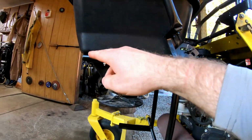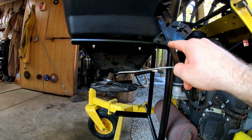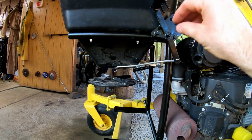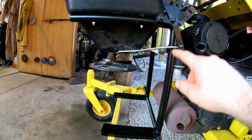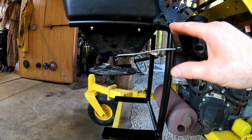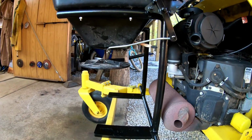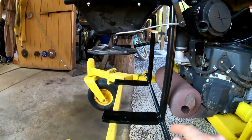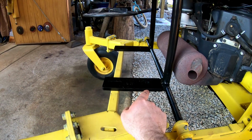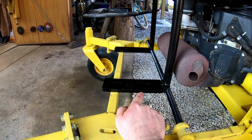So I figured out my height, and made this 90-degree piece of pipe right here. I just cut 45 degrees, welded them together to make that L shape. Once I had that all in place and the hopper bolted to it, I made sure everything was level and square, and then I welded on these plates, 1/2 inch plate, 2 inches wide, that I just had laying around.